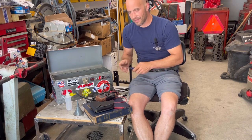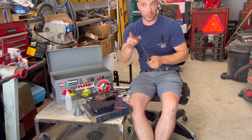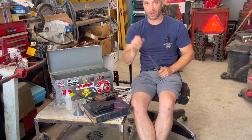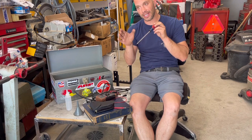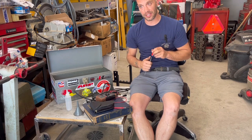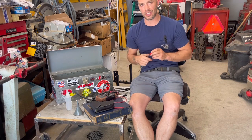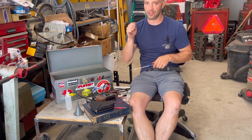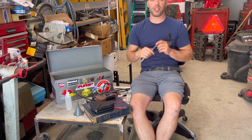Obviously a screwdriver — that's to set your throttle screws, adjust all that, and get it going. You'll notice we don't have a throttle. We don't actually use one. We actually use a throttle blade screw and turn it to keep it at 2,000 RPMs and let it sit there. Whack the throttle a few times when we need to, then back it off to see how it idles. This is a lot more precise and easier on the engine when you go to break it in.